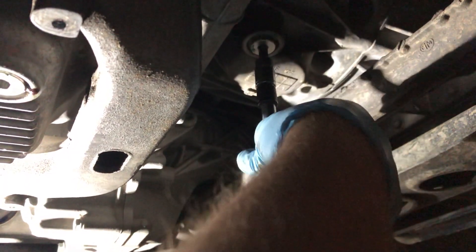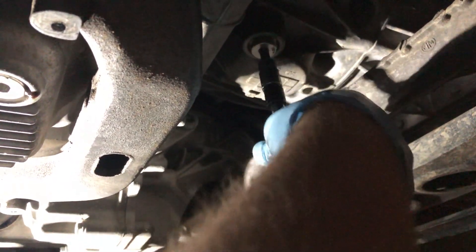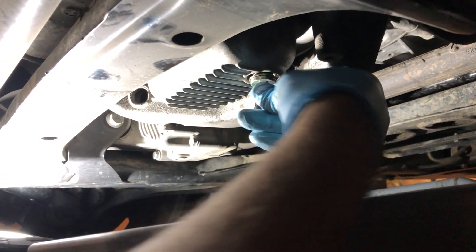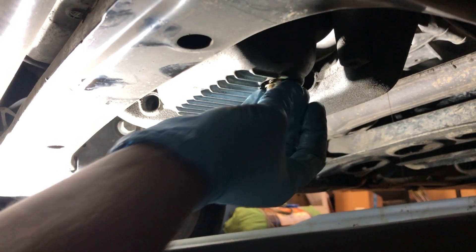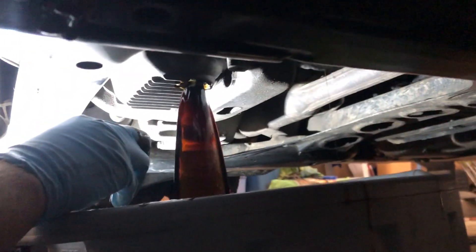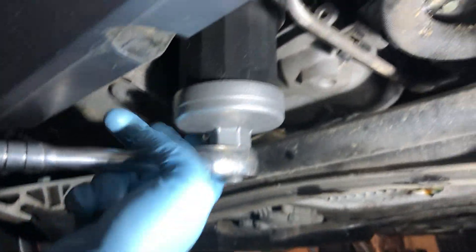With your 8mm Allen wrench, remove the drain plug at the back of the engine. There's also another drain plug underneath — this one only drains about a quart of oil. Make sure you run the engine after you remove the under tray for about a minute to let it get warm so the oil flows right out, but not so hot that it burns your hands. Now you're going to use your filter wrench socket — link in the description.